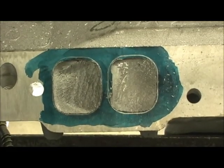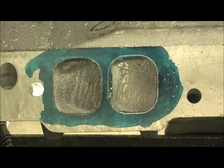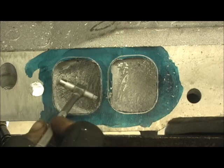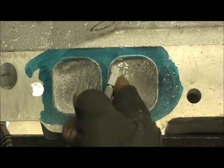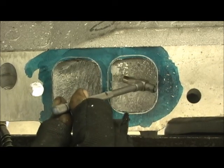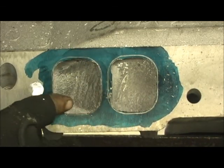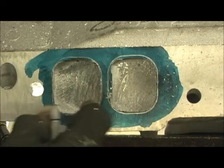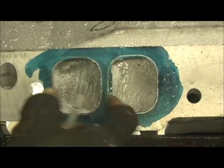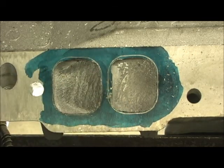Right now as you can see, this one here has its cross section cut back. What I typically do when trying to match it is come around and watch the divide as it tilts and goes sideways. With this one you can tell the chunk of meat — it has to go almost all the way to there before it can straighten out, about an inch and a half to two inches. I try to leave about 50 thousandths to the inside to allow for manifold movement; I don't go all the way through. You want to leave a rectangle in a rectangle, or a circle in a circle — that's what you want to do.